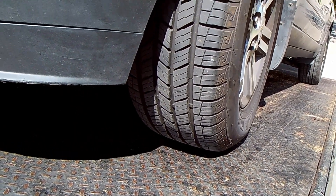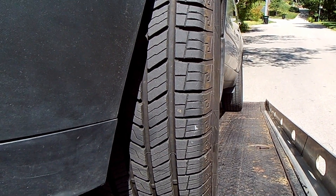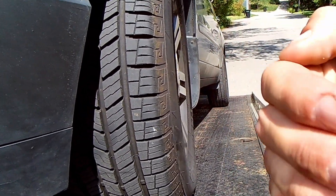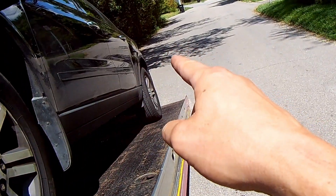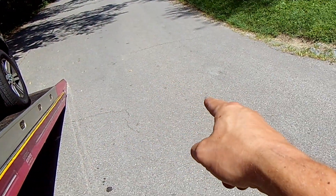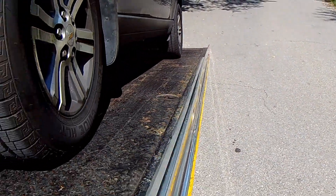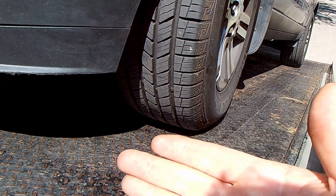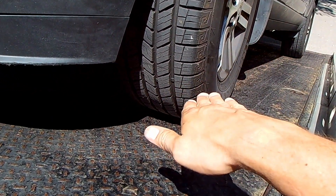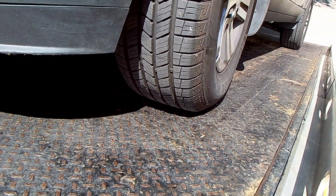That's a lot of times easier when you have tires that are turned out, because if you put the car in neutral, the vehicle is going to go in the direction of the tires. With it being turned out like this and having been back there, the vehicle would have ended up over here or running off the rails of the bed. So for the sake of control and keeping the vehicle going straight where I want it, you jam your skates up under the tires and it slides perfectly to wherever it needs to go.